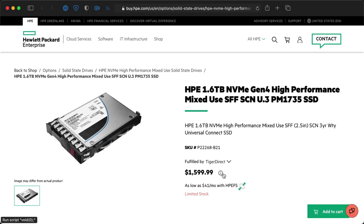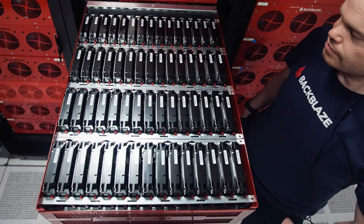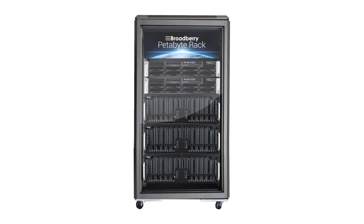I don't have a U.2 or U.3 NVMe drive on hand to test right now, but maybe that'd be a fun topic to explore in a future video. The card can connect up to 24 NVMe drives or a whopping 240 SAS or SATA drives to the Pi. My budget right now is a little bit limited, especially after that nearly thousand-dollar Wi-Fi 6 testing video, so I've only been able to test 8 drives at once so far. Maybe if this channel ever hits a million subscribers, I'll budget for a giant 240-drive Raspberry Pi petabyte NAS.